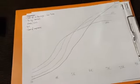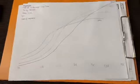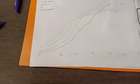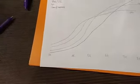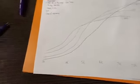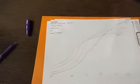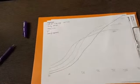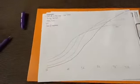It's working everywhere, and that's the advantage of those engines. If you can have big cams for top end and the big power, and small cams for the bottom end, for the fuel economy, for the smoothness, for how it runs, those engines are going to be unbeatable. It's very hard to pick one camshaft to do the job of two, whereas they've got two grinds that work within that engine. That's going to give it that wide spread of power.